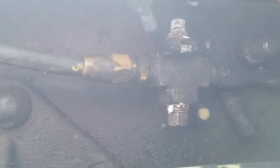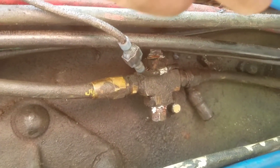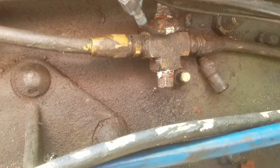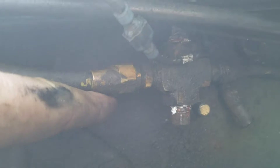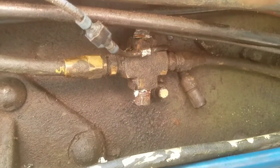Here's your front transmission mount — there's a block right here. You've got two lines coming off it: one goes to your linear valve on the front axle engagement switch, and the other one goes to the little round interlock solenoid on top of the transfer case in that bracket. You can either plug them off like I did, or get a male union DOT fitting, 3/8-inch — take this line off and this line off and connect them together. That'll just send your air right to the front and gets rid of all the air issues.